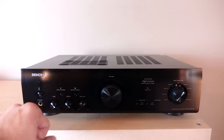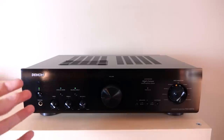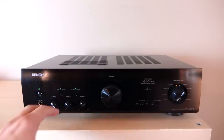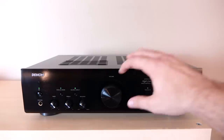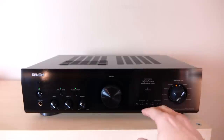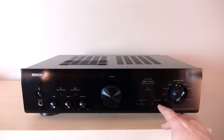We have an analog mode — if you have something connected via RCA, you can hit analog mode and that basically disengages the digital circuitry, giving you a more pure sound experience. We also have source direct: if you don't want to use tone controls, hit source direct and you'll get the best that this integrated amplifier has to offer. The volume control feels good — not too loose, not too much resistance. Then we have speaker A and B selectors. This amp can power up to four speakers simultaneously, but if you do that, make sure all four speakers are an 8-ohm or above load. It also has a built-in phono equalizer supporting moving magnet and moving coil.